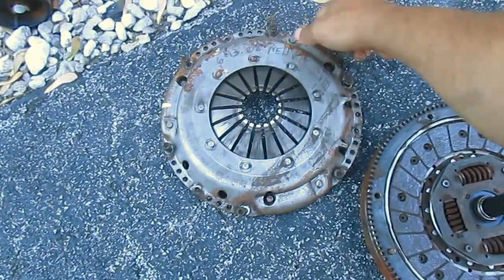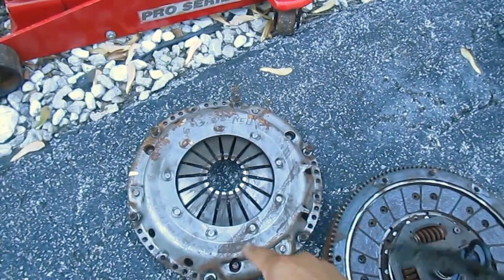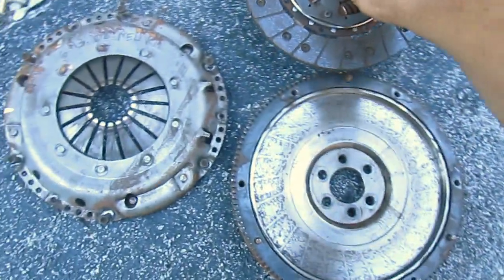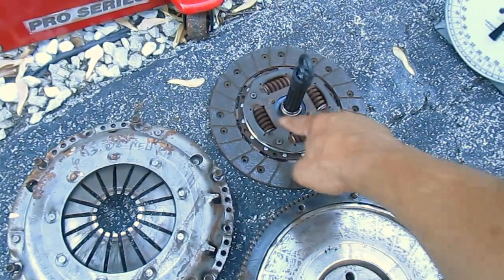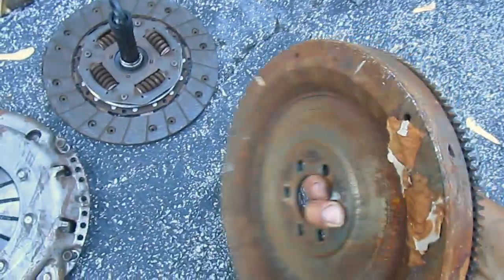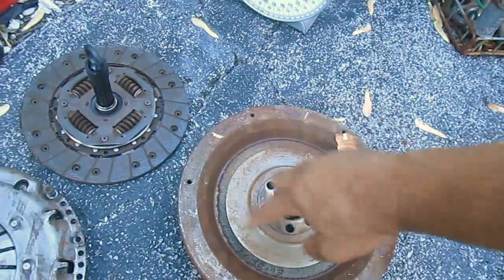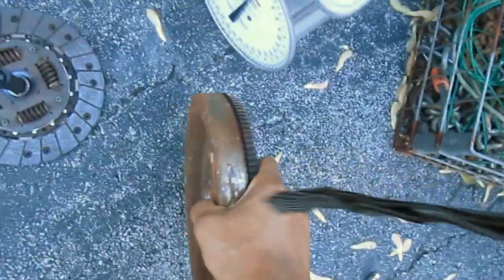I'm going to take this off — this is the pressure plate here with its six nine-millimeter twelve-point heads. It says here the clutch was replaced in 6/13, and that looks like '02 to me. Here's the centering tool. Remember how we can tell a single mass: the single mass has the high-tension springs — an outer spring and an inner spring — in the clutch. Here is the single mass flywheel. On a dual mass flywheel, on the back it actually has metal channels with springs and dampeners — it's two separate sections, that's why it's called dual mass.